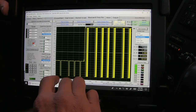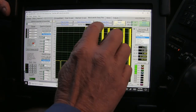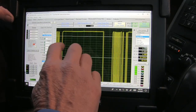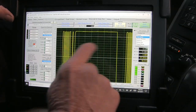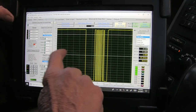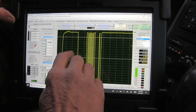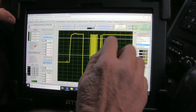Now we can see the difference here — before, we had no communication bits. Do you see how in these packets we now have communication bits? I want to open this up and we can see where when we drop this down we have communication, then we go off. This is how we're sending our information on this system — this is a LIN system, a low-speed system for the Volvo. Notice that we have the communication bits here and we're also at battery voltage. When we come back to where we have the problem, notice the bus is being pulled down to 4.5 volts. But as soon as we unplug the switch, we can clearly see that we get communications.